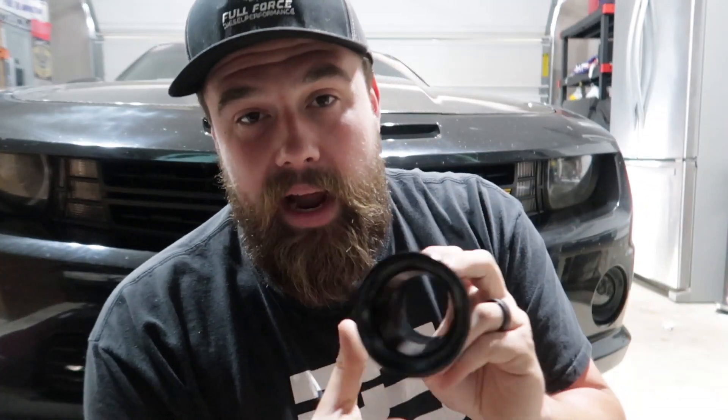That is what I filmed on that day. I had to end it there because I realized I have a headlight that doesn't work, which sucks because I just rebuilt this one — I basically bought a new ballast and wires and redid the inside. The housing is cracked, the lens has a hole in it, it's basically a goner. So this headlight is going to become my donor headlight. I'm going to take the good ballast and put it in the other one so I have one working headlight on the passenger side. I have LED fogs that are on all the time, but I want to thank Auxbeam for sending over those headlights. I'm very excited to show you guys how well they do at night — I guarantee even with one working LED headlight, it's going to be way brighter than the crappy HIDs. So we're going to pull this whole front fascia off to get to these headlights, which means the whole front bumper has to come off. Super easy — I've done it about 20 times with this car.